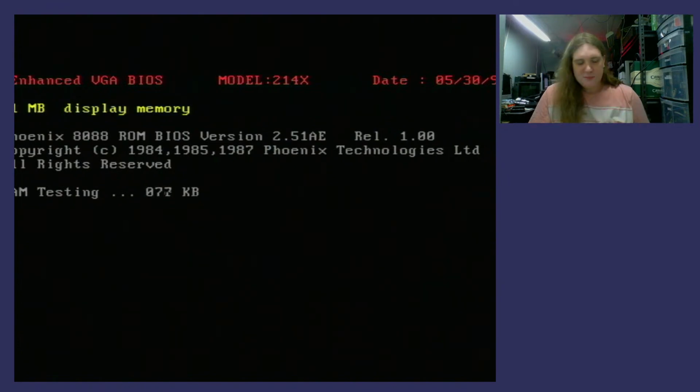Can you detail your system, please? Sure, it's an Epson Apex Plus. It's a Turbo XT system of generic design, like a generic Korean platform from 1988 or 89. It originally had an 8088 clone microprocessor. I switched it out for an NEC V20. I also put an Intel 8087 math coprocessor in it. It's got 640K of RAM, a 20 megabyte MFM hard drive on a card, a knockoff hard card. It's got a double density 3.5 inch floppy drive and a 5 1/4 inch floppy drive.